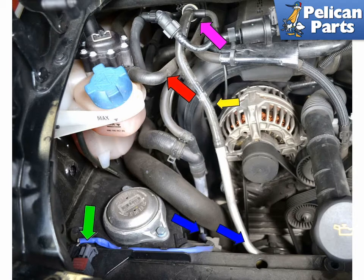On the left side of the engine, for the 997s only, unclip the brake booster pipe on the crossmember and lay them off to the side (blue arrows). Remove the plastic lines and the cable plug from the switch over valve between the intake runners, yellow arrow. Loosen the lines for the brake booster (purple arrow): remove the plastic protection, push the holder forward, and pull back off the line. Put the plastic protector back on right away to keep any dirt or debris out. Then disconnect the vent line for the coolant tank (red arrows). Check for slack in your wiring going to the O2 sensors on both sides — if it looks tight, disconnect the wiring (green arrow).